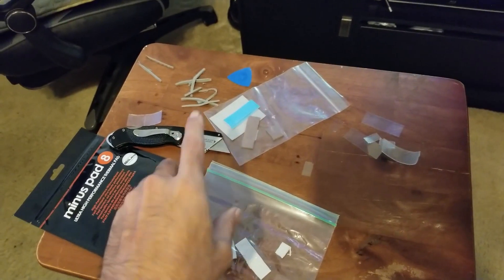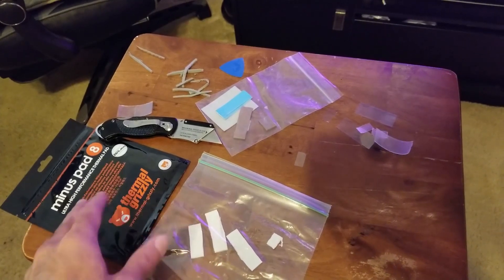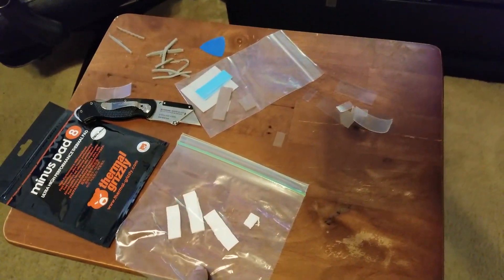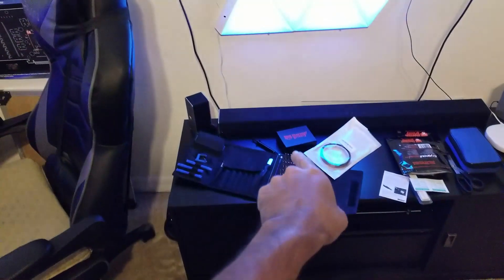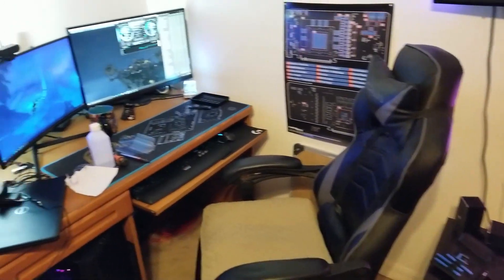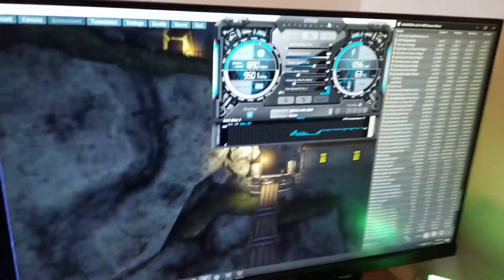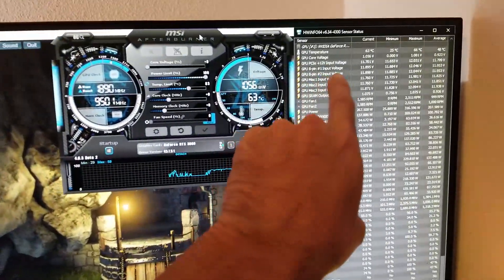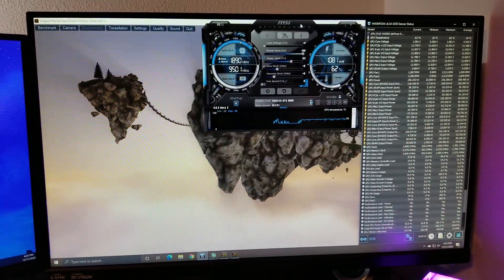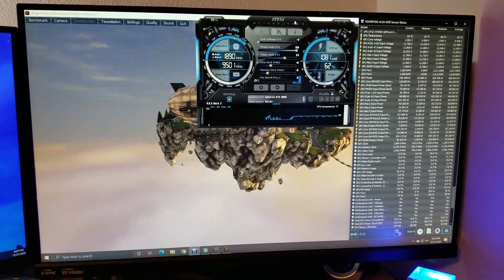The problem is 3mm is too thick — you want maybe 2.5 or 2mm; realistically 2mm would probably be the best. I replaced the oily pad and then it gave me trouble because the thermal paste I put on there, with the bulk of the GPU being squished, was not making significant contact. So I was having thermal issues — previously the GPU core was getting up to 84 degrees, so I knew I wasn't making sufficient contact.